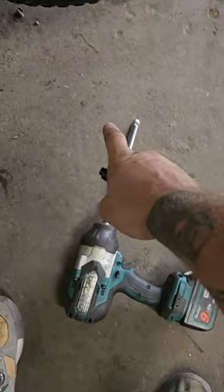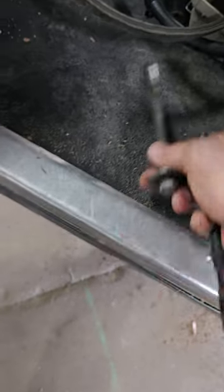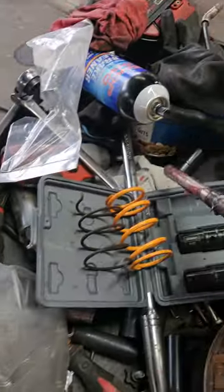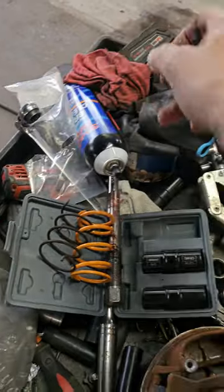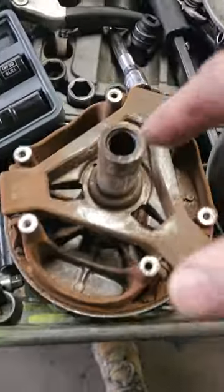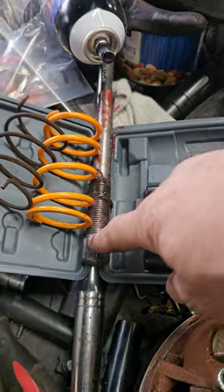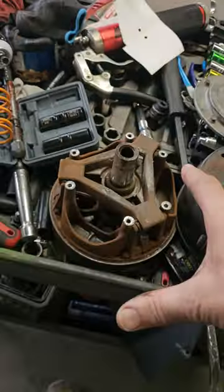Run an extension all the way up through — you can see it gets you right where you want to be. Pop off this bolt — remind me to put grease on that later. The trick: I used the extractor tool and put some grease in there to hydraulically eject it, but that didn't fully work. So I took the grease gun, jammed it all the way up the shaft, and let it pump out slowly until it reached the edge. Then I jammed the extractor in and just a couple of cranks and it all falls off.